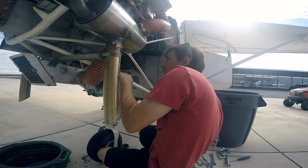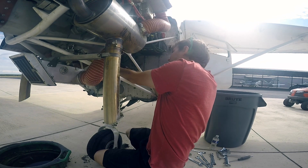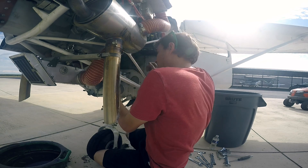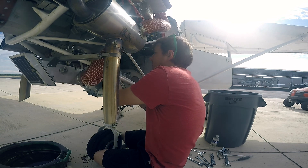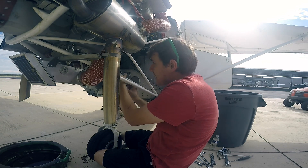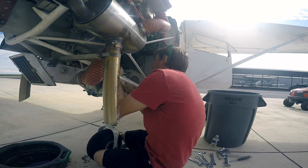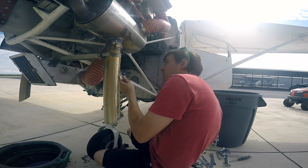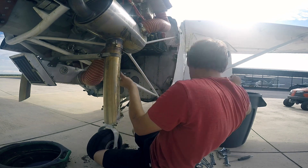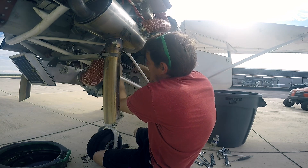That's very much on the high side, and then there's my labor. All in all, the owners have got about $180,000 in this 172, which seems like a lot. But there are a couple of things about this 172 that are different from your average one. First, it's going to be a rental aircraft, so it will make some of that money back. Number two, it's also eligible to be a T41 since it's a 1966 Cessna 172H, and the plan is, after this engine is timed out, it should have made enough money to pay for the T41 STC — which is a 200 to 225 horsepower IO-360 with a constant speed propeller — which would make this airplane awesome.